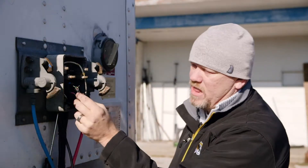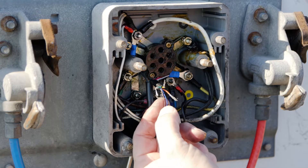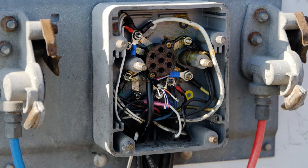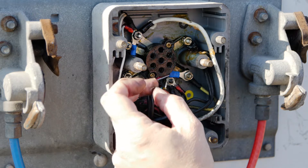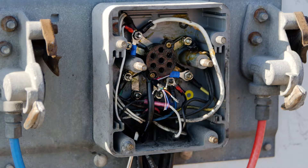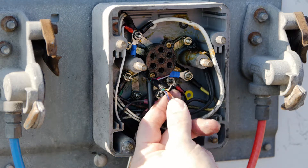Your green and yellow wire — those cannot touch. We want to make sure those are taped off and separate. Your other wires, the brown, blue, and orange, can simply be snipped off. It's definitely a must to make sure that the yellow and green don't touch even though we're not going to use them. One's an input, one's an output — we don't want a signal running back through there. So these get wire nutted individually, and the other three will get snipped.